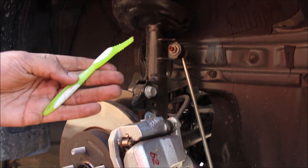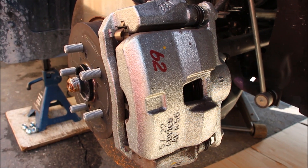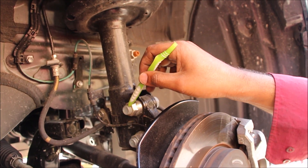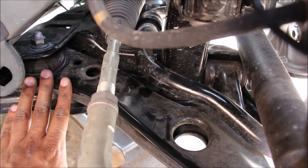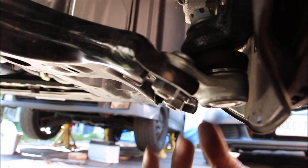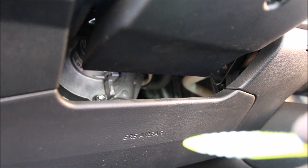Now we're going to have a look at what's behind the wheel, starting with the front. We've got a MacPherson style front suspension with a stabilizer link attached that comes down to the sway bar out front. In front of that we have a single piston caliper for the front brakes. We have a strong steel spring seat at the top, followed by a steel knuckle with no camber adjustments. Then we have the CV axle, inner and outer tie rods where they connect to the knuckle. At the bottom we have a stamped steel lower control arm with easily serviceable bushings, and a bolt-on style ball joint that's fairly easy to service without needing a press. Following the inner tie rods back leads us to the steering rack, which is electronically controlled by a motor underneath the dashboard.